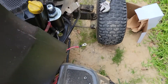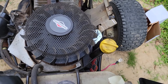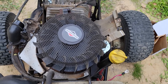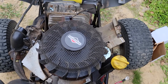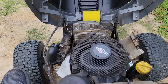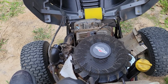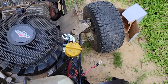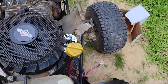The brake is locked down. I like this — absolutely no hesitation from that starter. I think I'm done. I think it's going to be a good mower after all. I had my doubts when I first brought it home. The original starter was spinning backwards — I think somebody took it apart and put it back together wrong. I repaired that, but it didn't have enough power to spin the engine around. The recommendation is to set the valves, so I set both valves at 4 thousandths, and it still had trouble cranking, so that's when I got the idea of doubling up on the cable thickness — 2-gauge wire all the way back to the battery.